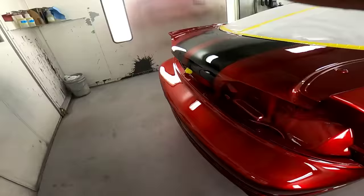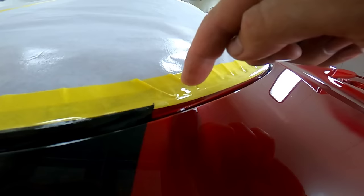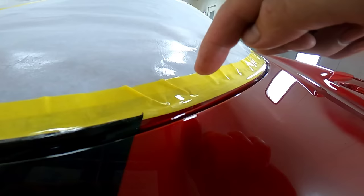All right, now as I get this coat finished up, I always like to do a little finger touch test where I started. I want to see that clear coat kind of string off like a spider web, where it's nice and tacky and just kind of stringing away, as you might call it.